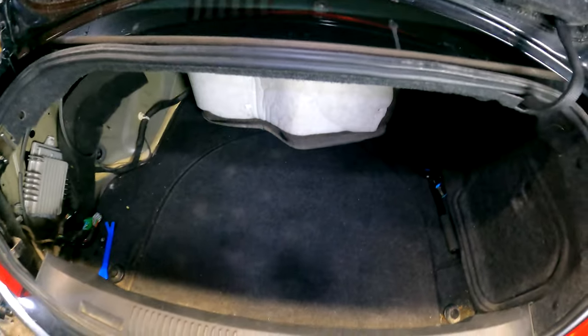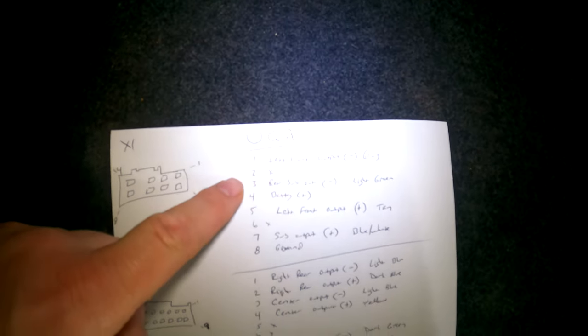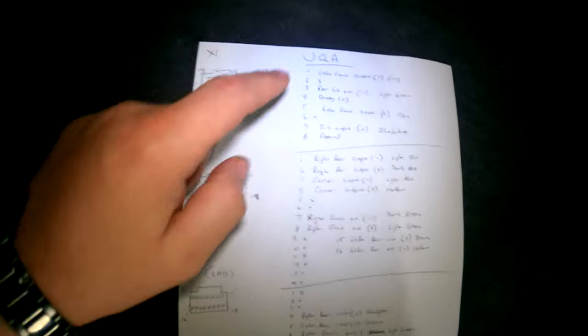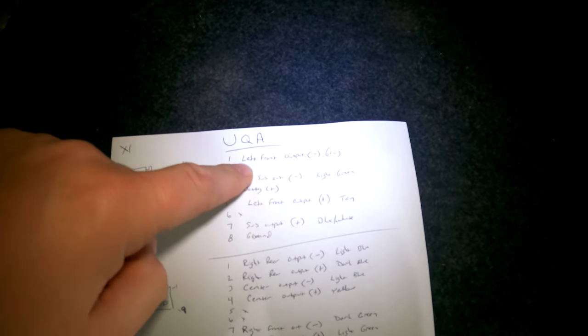There is one more way to check which amplifier you have — whether it's analog or digital. In your trunk, if you get your spare tire cover and lift it up, you'll have a tag back here: service part identification. It lists all the codes for your car for all the different options. Go down to the audio option and right there you can see UQA — that's another way to tell which wire harness you're going to get. I actually went through the wire harness diagram and wrote down all the wires on the corresponding harness for just the UQA code, just the stereo that's actually in here. I'll type this out and put a link in the description so you can print it out and see the wires you'll actually need. And if you ever decide you want to add a sub and use a line-out converter, this also shows which wires would be used for that.